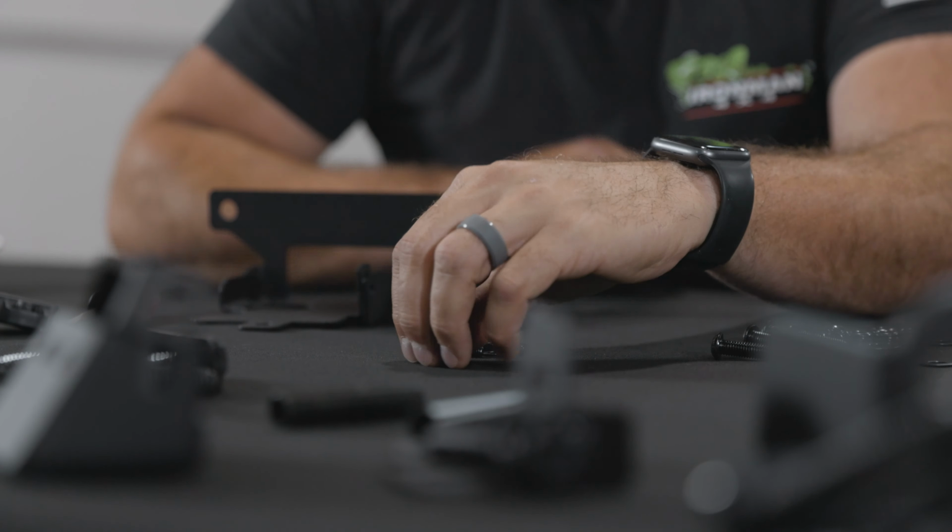And if your kit came with a section of windshield washer spray hose, you want to grab that. I took my factory sprayer and I cut the fittings out of it because I didn't want all the 90 degrees and all that. So I'm going to take this guy here. I'm going to fit that on like this. Then I can plug that back into the sprayer at that junction there. That keeps it nice and clean. Then we can twist that around. And then everything can run up right behind the light bar, and we'll run it through here. I'll put the other fitting on the other end. We can hook it back up into the truck.